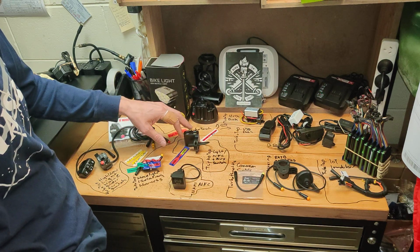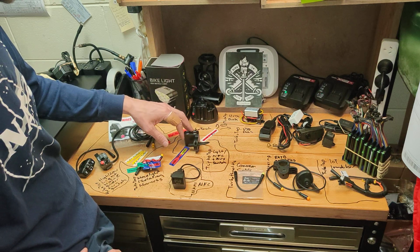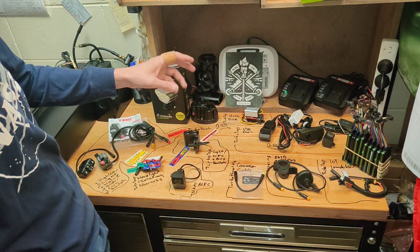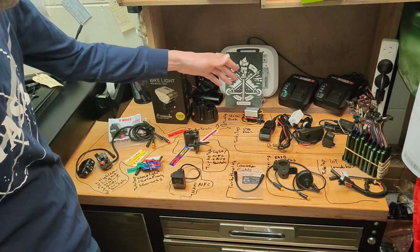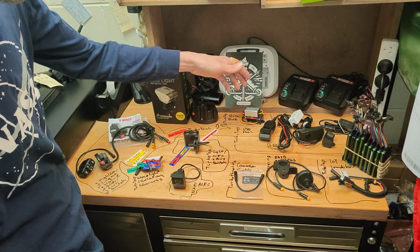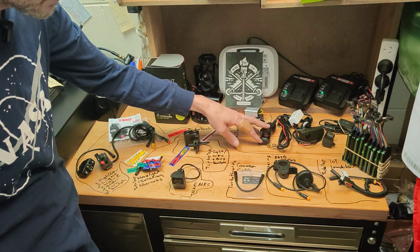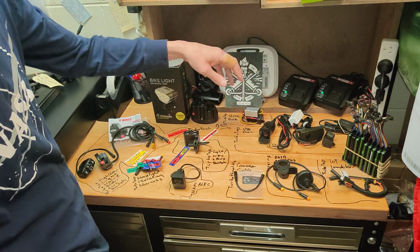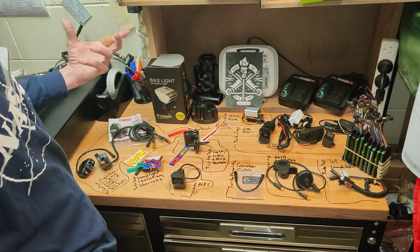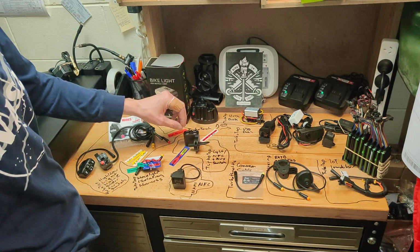The other switch on this dual switch is an auxiliary switch. So that just provides external power out, which is always on, and that allows you to drive a TurboTap buck converter, which delivers 12 volts, so you can run things like quick charge USB chargers quite happily. So first switch is for lights on and off as like an override or NFC bypass.